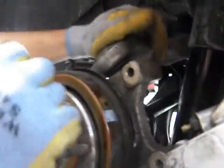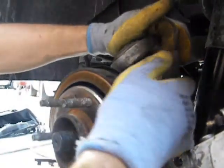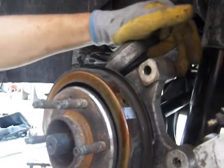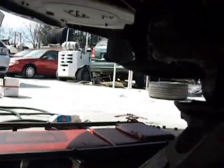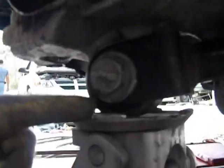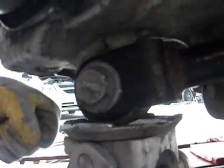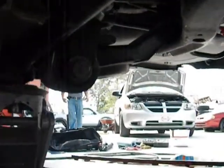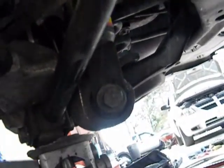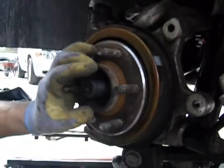Then screw in your ball joint with the nut, the factory nut. And then after that, you get down here with your suspension spring and everything like that. Get that through. And then this here, lower control arm, get a 21mm wrench on one side and your gun on the other side. Get that on. And get the bolt through here on your tie rod. And finally, your shock right there. And that's all there is to it.